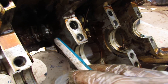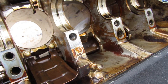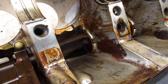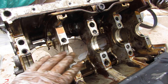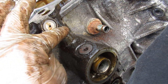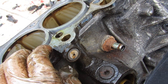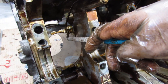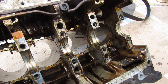In addition, the oil galleys also feed the bearings for the balance shafts on either side. The balance shaft is basically a semi-circular weight that rotates to counter the secondary moment of inertia generated by typical 4 cylinder engines, making it run a little smoother. From the oil filter the galleys also split off to feed the engine head, lubricating the camshafts, rocker arms, and the VTEC system. Inside the block you can also see oil sprayers that coat the cylinder walls with oil to aid with cooling as well as lubrication.